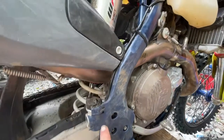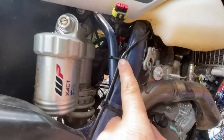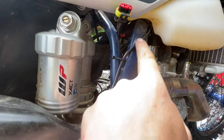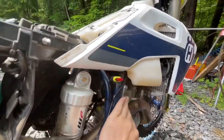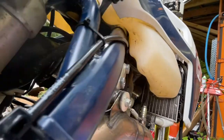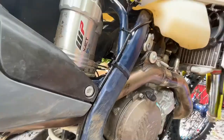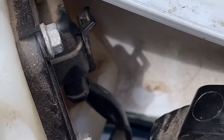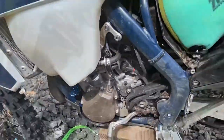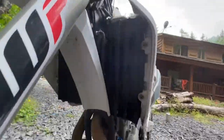You may want to check the install videos and the routing, but I like how this comes up. I'm pinching right here at the little one and coming across, and that cross is really out of the way — it's not in this plane. Then it just sneaks up without hitting the tank. Be sure to remember you plug in your fuel injection and of course hook up your fuel. The system's looking good — tank's on, just five bolts to make that happen.